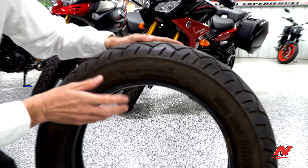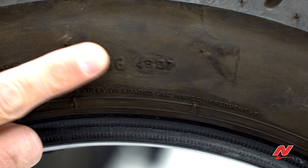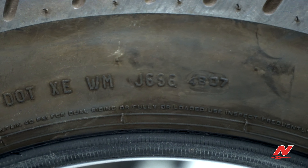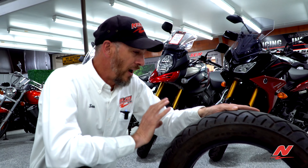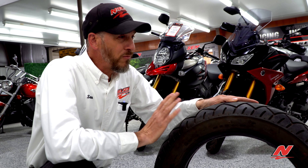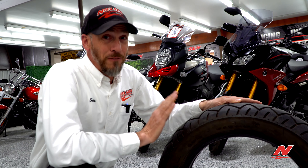This one, for example — all tires will have a date code. It's a four-digit code next to the DOT code, to the right of it. You can see this one says 4807. That means this tire was manufactured in the 48th week of 2007. Definitely needed to be replaced. There's a little bit of discussion on how old a tire can be. A lot of people use five years as a cutoff. If you're going more than 10 years, it definitely needs to be replaced.